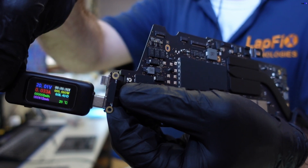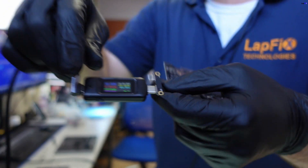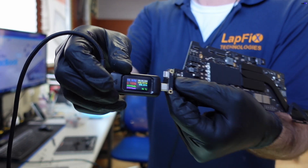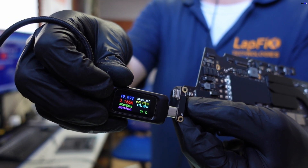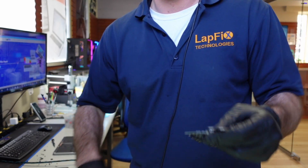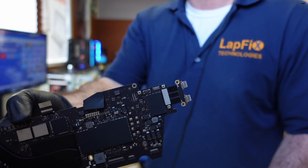We're getting 20 volts, which is good. I like using this meter a little better. The processor is getting warm now — on the M1, you need more current when you press the power button, so the amperage will go up a bit. Right now it's showing 0.16 to 0.13 amps, but we're getting the right voltage. That looks like it really was just about the port — there was just damage to the port.